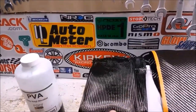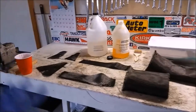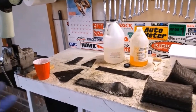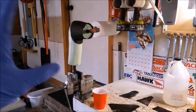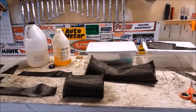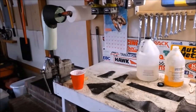We're going to be using a carbon fiber tube. Everything is ready to go — it's a great idea to go ahead and cut some strips out beforehand that you know you're going to need, because once the resin is poured and mixed you are on a time crunch. It makes it a lot easier if you plan ahead and think through what's going to go where. I've already got the first piece applied exactly how I want it, so I can just start working from there, be a little more relaxed, and make fewer mistakes.